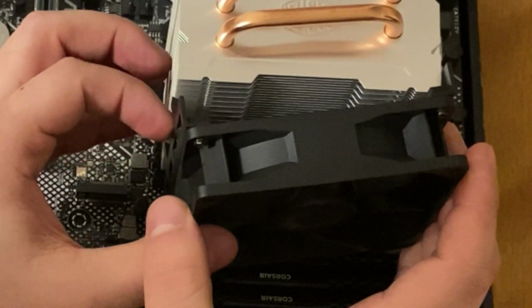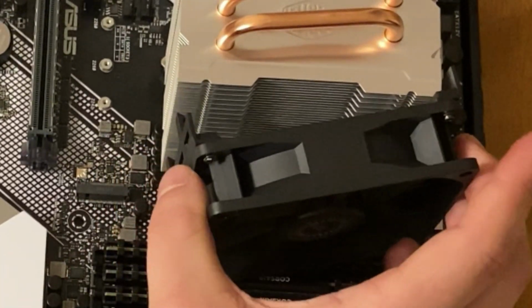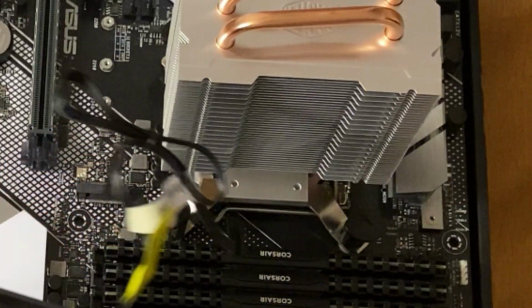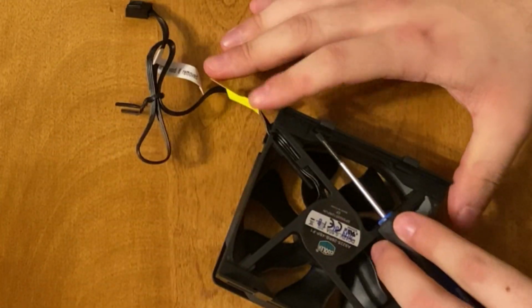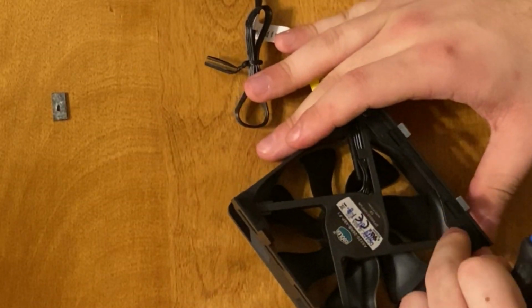So the next thing I noticed is that the fan on the CPU cooler couldn't fit. So I bought a Cooler Master cooler, but I had to buy a smaller cooler, not their big size, because of the RAM. So since I was installing 4 sticks of RAM, the cooler actually had to be swapped to the other side. To do this, I just had to remove these plastic tabs on this fan to reveal the screws, because I wanted to swap the direction of airflow so that the air was still flowing towards the back of the machine and out the back of the case.